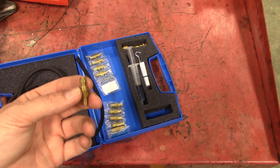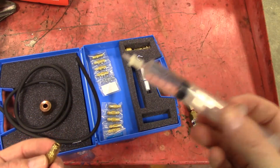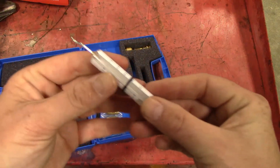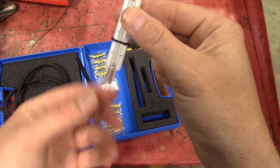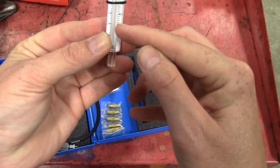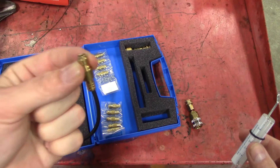The first thing we have to do is put a little water in this orifice, because the sealant is going to react with water. They give you this little syringe and you just use tap water to fill it up. This is your flow meter. How this works is you have a little ball bearing — a little BB in there — and the refrigerant will flow through here and you'll have a meter reading. You set this rubber band to whatever it's reading at, and then if this falls, that means there's sealant in the system trying to stop up the little hole in here.